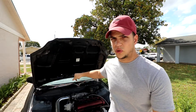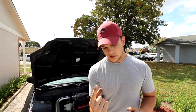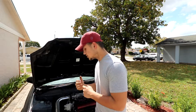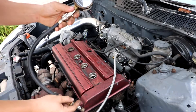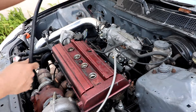There is not a place, there's nowhere that I go — the track, anywhere — where she is not getting rev limiter bounced or power shifted into the next gear. This car is currently on 14 pounds of boost, which is a lot for a B20, and she is also on 23 degrees of advance timing. The more boost I add, the more timing I pull out to help. She's also still on 93 octane.